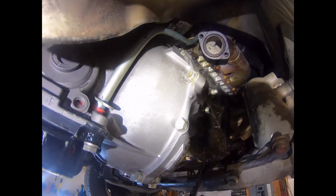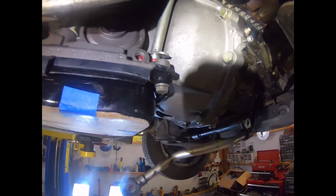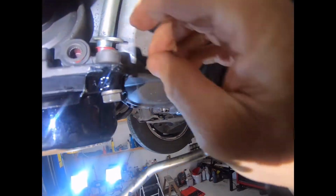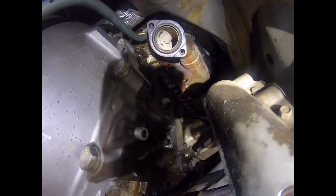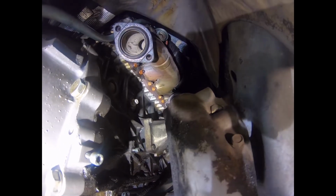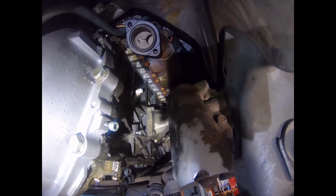So the automatic transmission dipstick tube is kind of a pain. It fits in here. There's an O-ring that goes there. But there is a place where it bolts onto a bell housing up there. And then way up off the head, there is a place where it bolts onto the side of the head. So, tricky to get in and out.